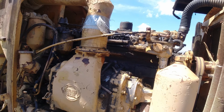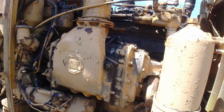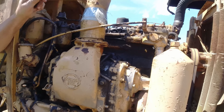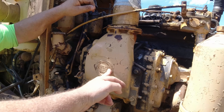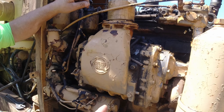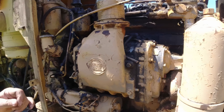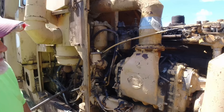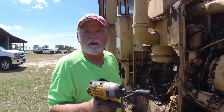We got the mystery oil down into the cylinders, but we may have another technique. I talked to my friend Scott over at Bus Grease Monkey, who is the resident Detroit Diesel expert, and he told me that sometimes you can take this blower cover off and you'll see a rat has built a nest in there. Your engine may not be locked up — if the blower is stuffed up somehow, the engine won't turn. He sometimes stuffs shop rags in there to torque crankshaft bolts. Hopefully it's an easy fix. A viewer had commented about the blower as well.